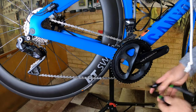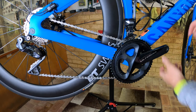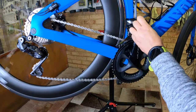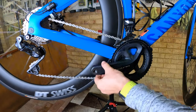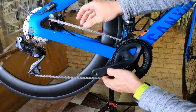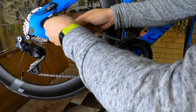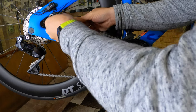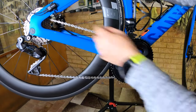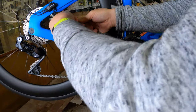Now it's just a matter of linking the chain back up. Give it a few revolutions to make sure there are no stuck links. You can see as it's going around there are some stuck teeth, so you've got to identify where they are as they come through, then go through those links and give them a bit of an extra turn. This is why you test it on the stand rather than going out on the road — just make sure they're all going to turn freely.